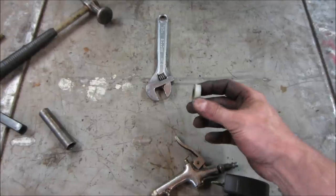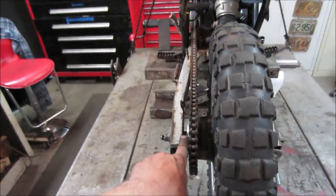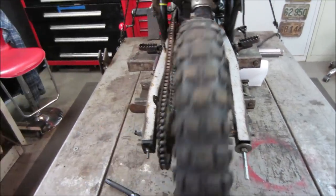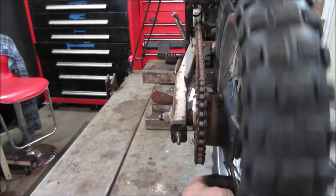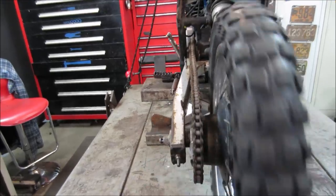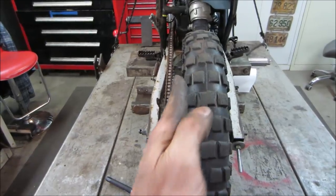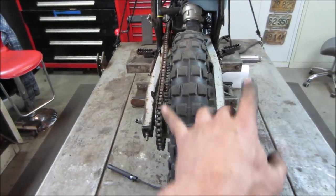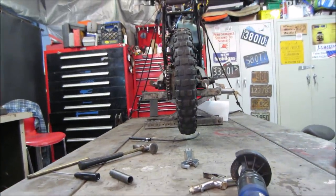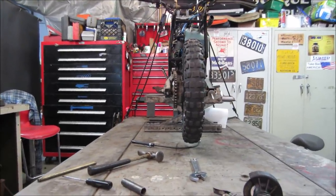So I got rid of the plastic bushings and bearings and crap that they had on it. There's one heavy spacer in, and I just left that length sticking out that we had to work with. It actually looks pretty good. The chain's kind of crappy. I don't see it minding. If anything, the tire could probably kick that way just a hair. Either that or, like we said, the swing arm is out a little bit. But I'm going to try eyeballing down the tire to the front wheel and see how we track them, so I can get that lift out of our way.